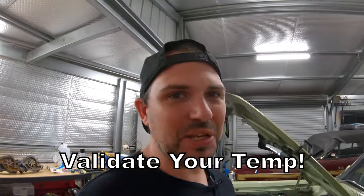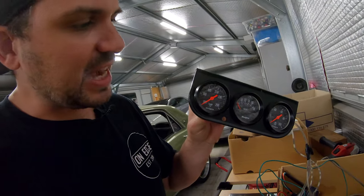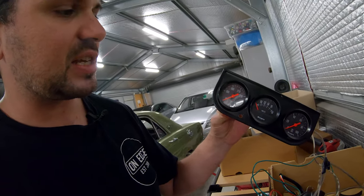So if you've got a car like this, or you've bought a muscle car or a classic car that's got an unknown condition cooling system, and you are getting hot, these are the steps I'd take to solve your overheating issues. First things first — are you actually overheating? If you're pissing out steam from your radiator, yeah, you are overheating. But if your gauge is telling you you're hot but your car doesn't seem hot and it's running okay, verify that it's actually running hot. Go get a cheapo mechanical temp gauge like I've got here. This one came from Summit Racing and it did a good job. Stick it in a port in your car and see what it does — you might actually be running just fine, it's just that you might have a shit gauge.